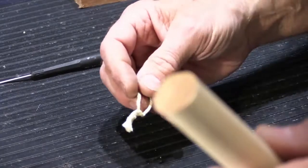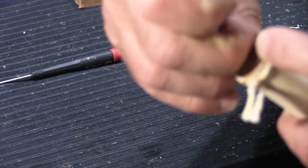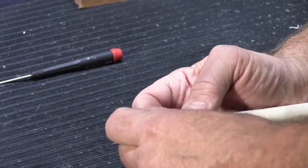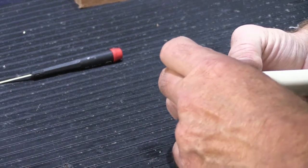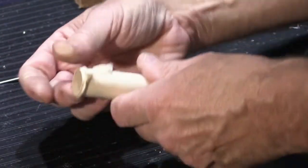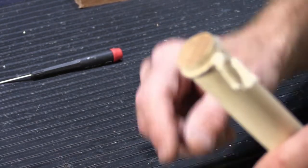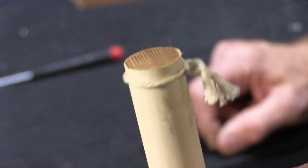And I know for a fact, because I've done many of them, that most NuTone chimes that have cord hangers like this use a 3/4 inch diameter loop. And if you take this and roll it over the end of the dowel, not always as easy as it sounds, you will end up with, like that, nice and snug. Fits around a 3/4 inch dowel pretty perfectly. So that's the size of hanger loop that we're going to make for our 3 NuTone brass tubes. There you go, 3/4 of an inch.